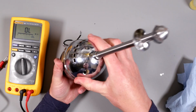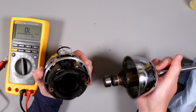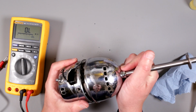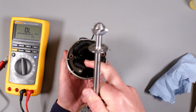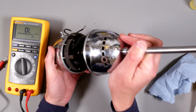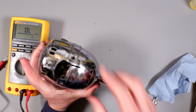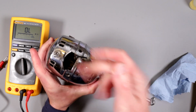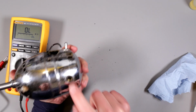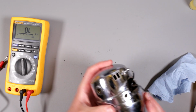Okay. Oh, it springs. Where is this springing? Oh, there is a spring in there. Oh, now I got it. So under this, right down there in the very bottom, there is a spring where the bearing lands, and it actually pushes it backwards. But that's all right. So we have to secure it like this. Those two wires are connected straight to the mains, and we need to also put the brushes back on. But let me secure this guy first.